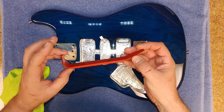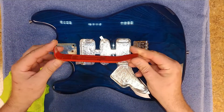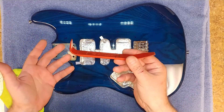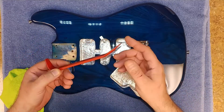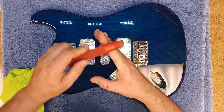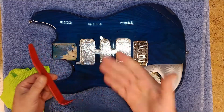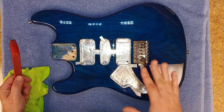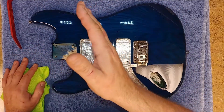I've got this prying tool for automotive use — for prying panels. There's a whole set of these for prying door panels, dash panels, anything clipped together. It's just got a hook on one side and an angle on the other. I use this for car audio interior work and for routing MDF — I'll use this tool to tuck in and make nice sharp lines. It works great here too because I can flatten everything out really nicely and get around the edges to tuck the corners so they look nice and sharp.